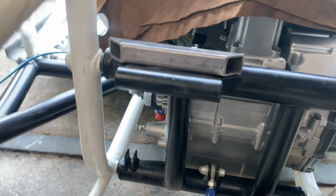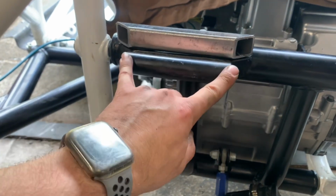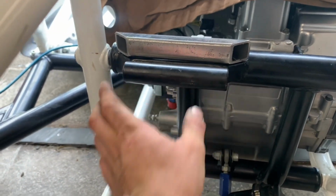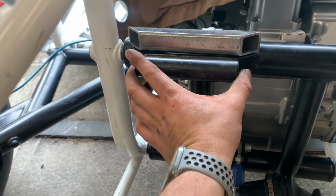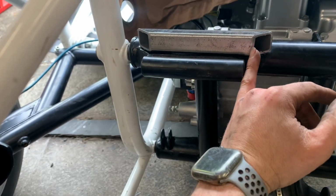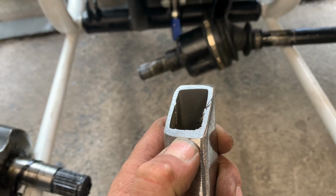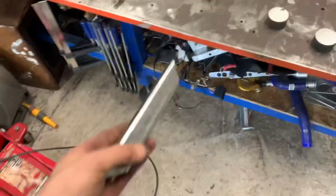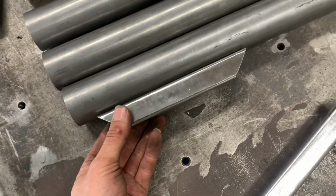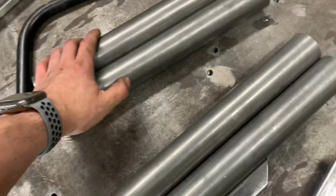Right, so we've got to end cap them, and then this goes on. This is 4 7/8 long, right? I don't know if that's critical, but I'm going to replicate it. So it's 4 7/8. So the inside of there to the inside of there, like from the start of the 45, it's the same. And then that's going to get cut, you know, like blanked off. And this will get welded to there with the 1-inch bar here. So you've got two tops, two bottoms.